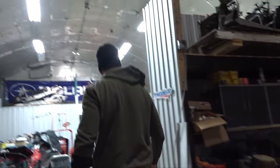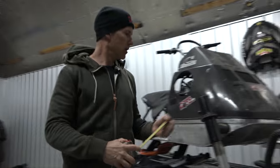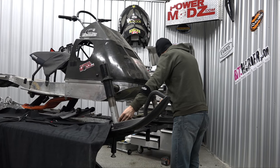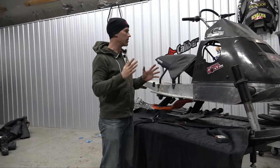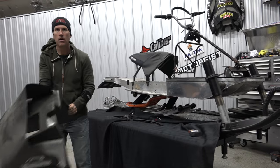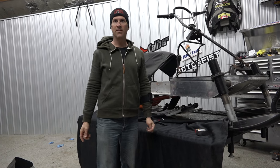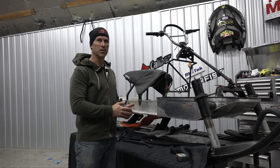What do you do for a track? I'll still use the 174 track, but I'll just cut down the sides on it — cut it down to 13 and a half inches. So the most applicable snowmobile at that point? I'm using the ski stance on this, center to center: 35 inches. That would help me deal with a lot of the issues. With a 925 and a 13 and a half inch track, are you not just going to trench? Well, not when there's 174 inches of it. Everything trenches with a lot of power, but it depends on the suspension. With this suspension here, that's like an anti-trenching suspension — it's coupled and it works really well.